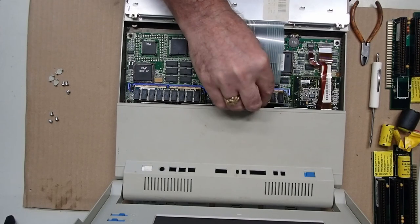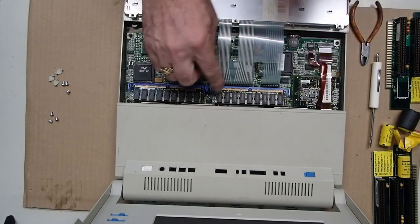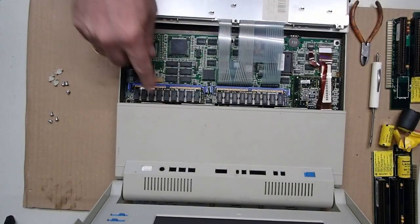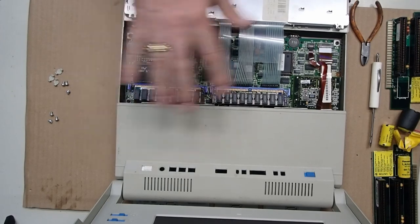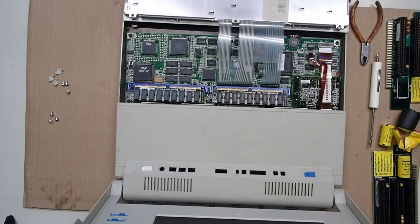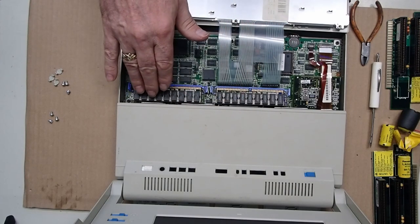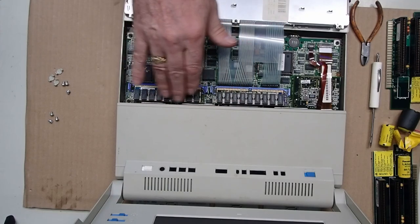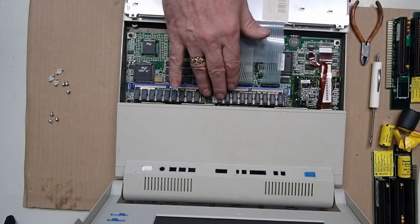But I really like, with stock components, that this unit has the 8 and 8 making the 16 megabytes and the 2 megabyte on the system planar. And so it uses that spare 2 megabyte with that expanded memory manager to still make effective use of that memory with these NICE modules in there. And even though it's really hard to find, that's why I say I can bring up modifying the modules and show how that's done as well.